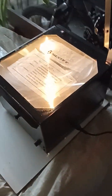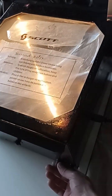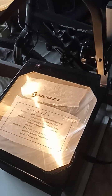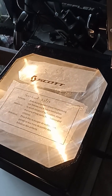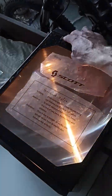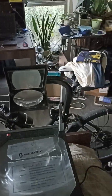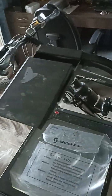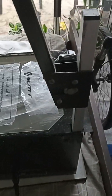And now before switching off, we can just dim it all the way down so that the lamp can cool down a bit before the fan stops. Okay, this by the way can turn down completely, so you just have flat head, and the support can be removed so that you can box the projector and put the arm separate.